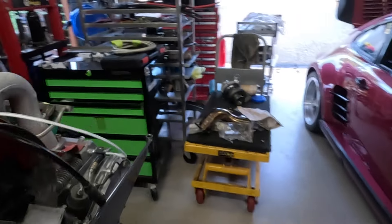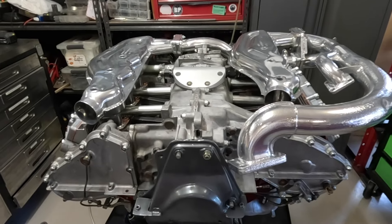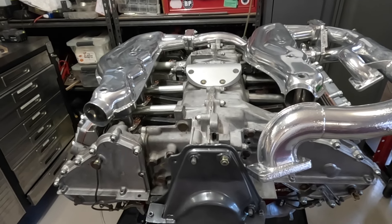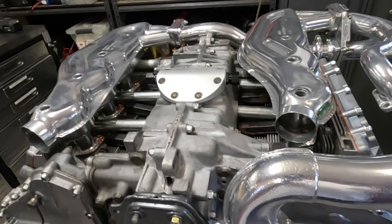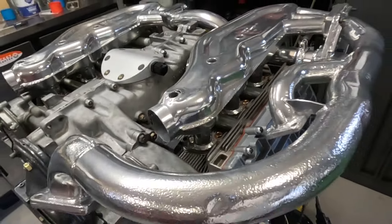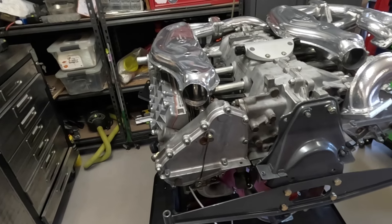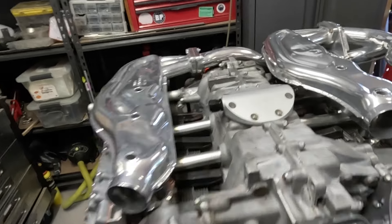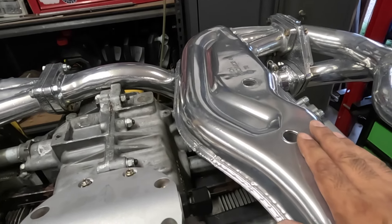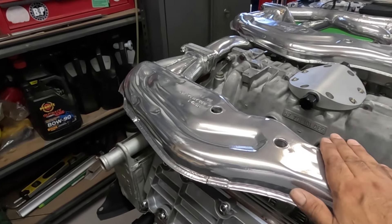We're going to talk about the oil drain as well so I'll flip the engine over and show you what's what. Because this is a conversion to turbo and not a purely built engine for a turbo, I haven't gone to the expense of equal length headers. These are actually the stock original heat exchangers for a three litre SC motor - just the normal thin flange ones. What I have done ahead of all this is I got them ceramic coated.